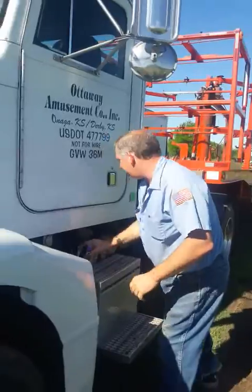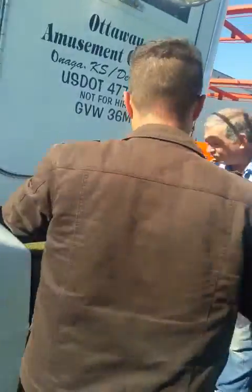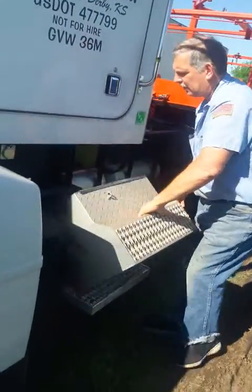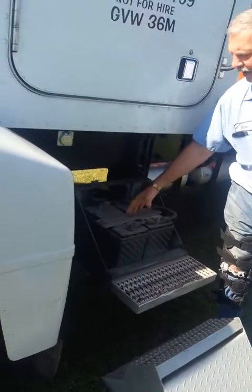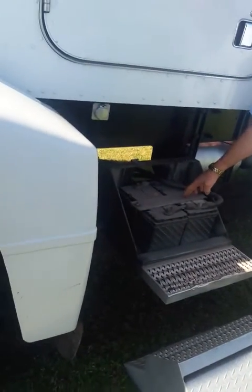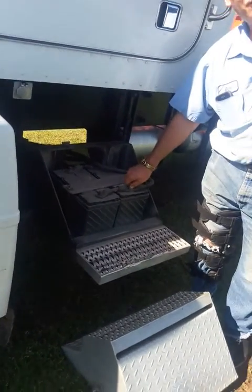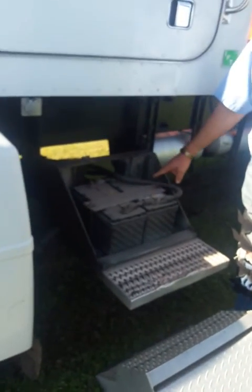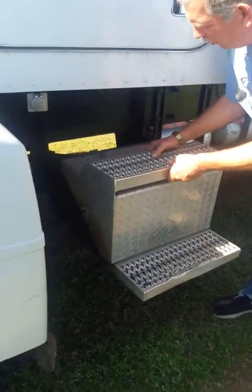Now, you don't have to do this during the inspection, but I want you to see what you're going to be telling them you're looking for. This is your battery tray. You want to make sure that they're properly mounted. Make sure that the batteries are not leaking. Make sure that the terminals are tight. There's no corrosion. And there's no bare or broken wires. Then you, like, say during the test, you do not have to take this off. You just tell them you would.